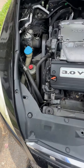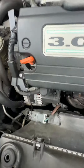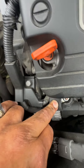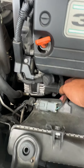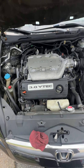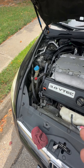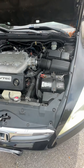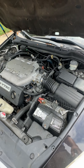On all alternators, there are two parts. One is the main — right there — which goes straight to the battery. The other is the control side, which I can't unplug because the car won't run right. The computer is telling it, according to the load of what you're turning on or doing, to change the voltage up and down to compensate — like when you turn on the air conditioning.